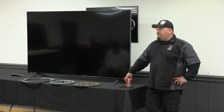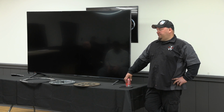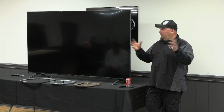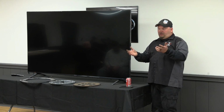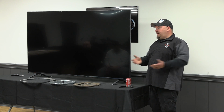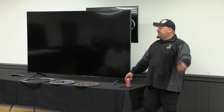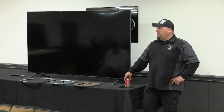The trucks that came with the V6, is that the same 4L60? It's the same 4L60 physically, electronically, everything. The bell housing and the converter is different. There's been issues with the converter, it's actually smaller, and a regular 4L60 converter doesn't go back far enough and it hits. Something I ran into recently, I was told it may not be true, but I'm not going to say it's the same when I don't know for sure. With the hole pattern on the bell housing, it's a 4.3. It doesn't have the top hole. That's why the bell housing is different. And it doesn't have the lower one to tie it into the oil pan.